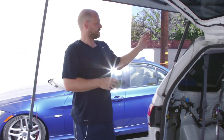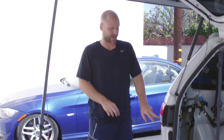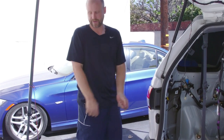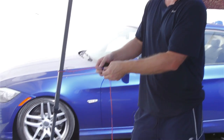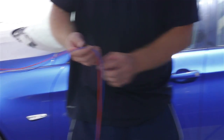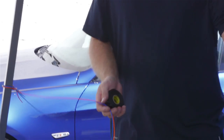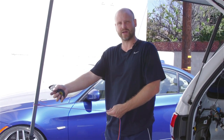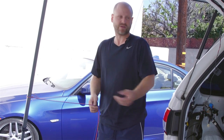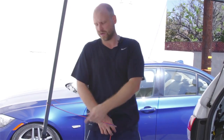In our particular system we're going to do two things. We're going to supply power to the camera as soon as the vehicle is on, and we need to supply the reverse trigger to the monitor. In order to do that we just take typical wire — in this case we're going to use blue for the trigger wire and orange to power the camera. There are a couple of little tricks: one is you can tie the wire off to something and put the opposite end in the drill to do a nice twist. You can also tape it, which is what we're going to do in this case, to make it look like all the wiring in the rest of the vehicle.